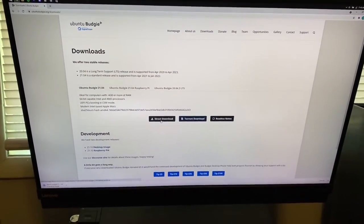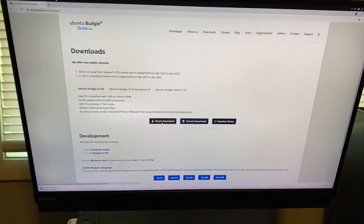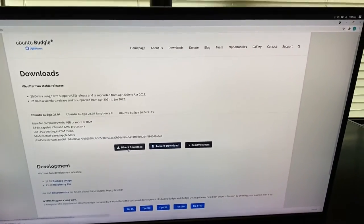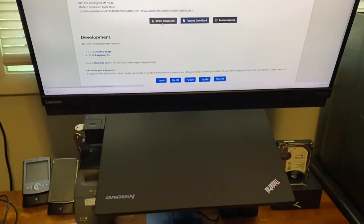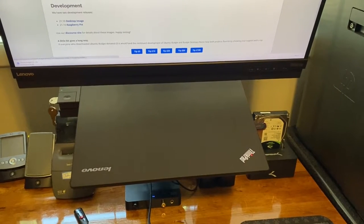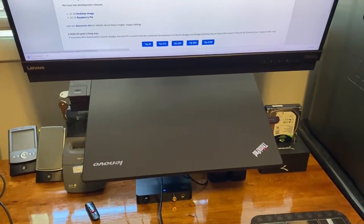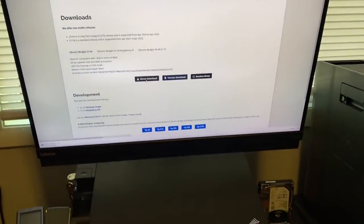This is my older 4K Lenovo ThinkVision panel. You can probably tell there's a bit of blotchiness going on over here, so it's been relegated to a secondary display just for laptop usage. And it's actually running at 1440p because this laptop can't do 4K 60 out on it. The internal video is just not good enough. I think it's an embedded NVIDIA Quadro of some kind, but it's a real low power thing, and it just really can't do 4K 60 as far as I can tell.